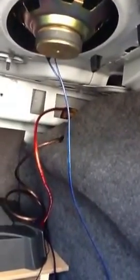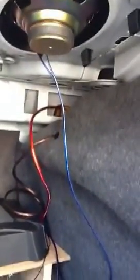It goes under there. And here you start to see it because I can't really tuck it in anywhere. But it runs up here beside my seat. I tuck it back in there. My power wire goes back down through the trunk right there. These are the only places I can get to my trunk right here. I've got my remote turn-on going through my seatbelt terminal. Yeah, it's broke, but it's a simple fix. I'll show you here. Right there's the red power wire coming out. And my remote turn-on wire, right there it is. It's coming up through there.